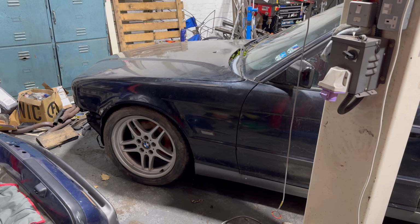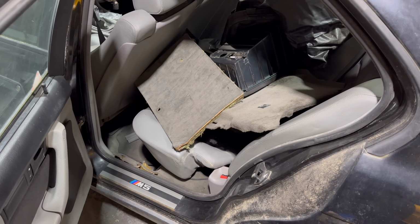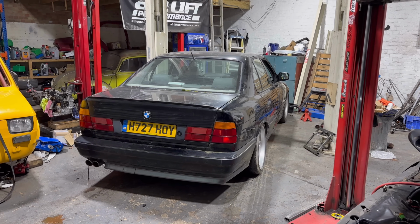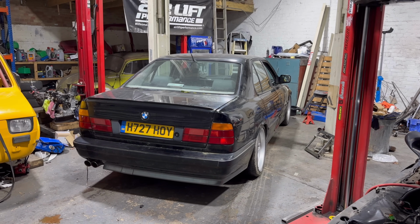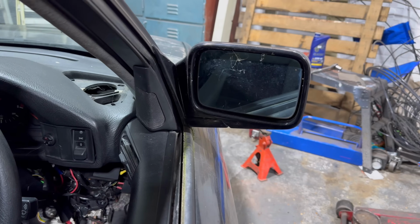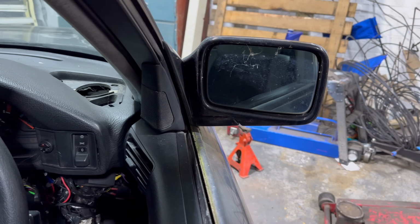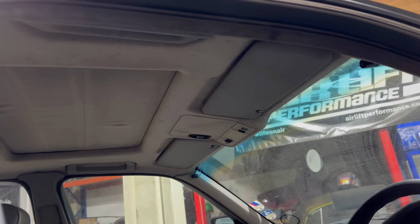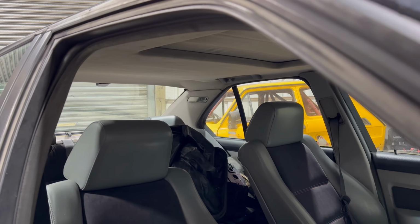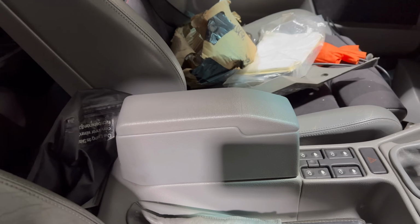Now this only started misfiring when it got up to temperature, so there is a possibility that one of the ignition leads broke down once it got to a certain temperature. It's kind of coincidental that it also ran out of fuel at the same time. Could be either one. Either way, we need to investigate a little bit further, but I can be pretty happy that it was healthy before it started misfiring. As you all heard, it runs super smoothly.